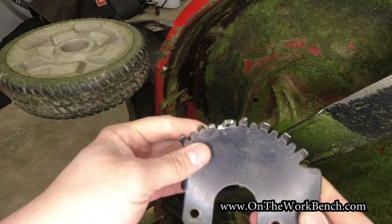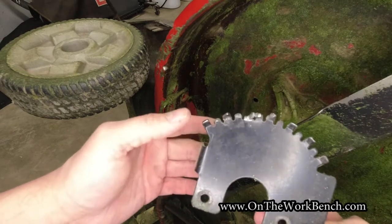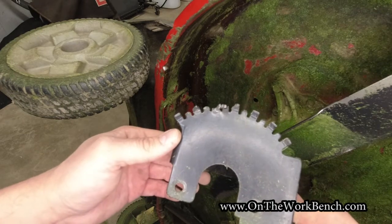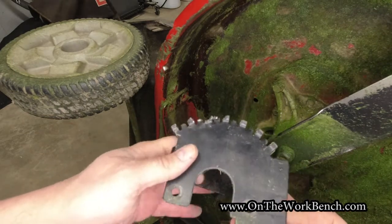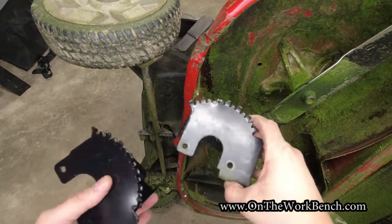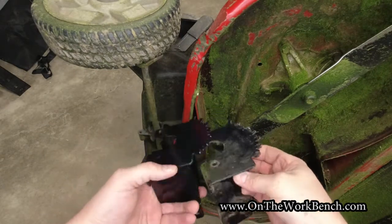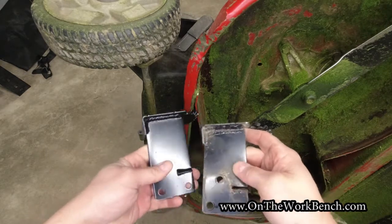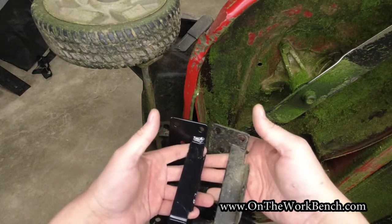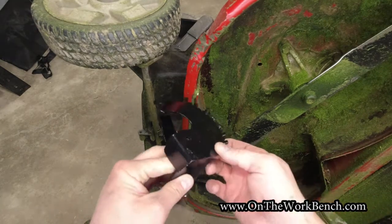You can really see how this got chewed up — that's why it's no longer holding. The obvious symptom was that the mower deck kept squatting all the way down to the ground. Before reassembly, I'm holding the removed part in my right hand and the new part in my left. I want to make sure these are indeed the same correct part — everything lines up, same size, holes in the same spot. Everything looks correct, so a quick moment there can save you lots of frustration later.